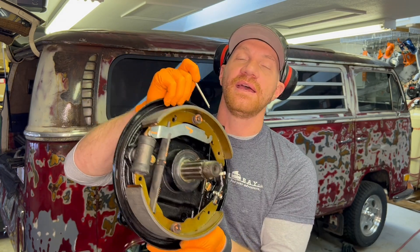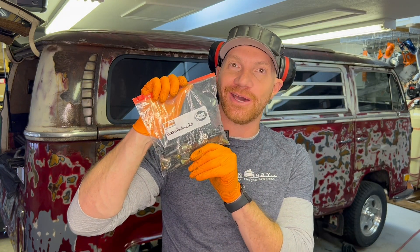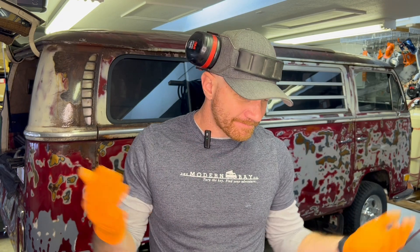Another thing I see quite often: on the axle stub there's a cotter pin that goes in the end once you get your castle nut back on. These are often undersized — you need to get the correct size for this. What I actually do is I have hardware kits bagged up that include all the new hardware I use for every single rear brake build. Give me a shout if you want to buy one — it includes all brand new hardware like nuts and bolts so you're not hunting for stuff and making 15 trips to the hardware store. That's why I put them together for the shop and it makes the job way easier.